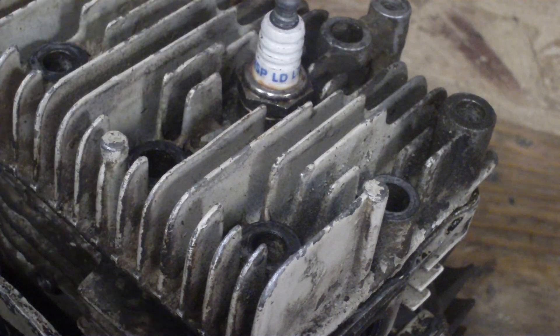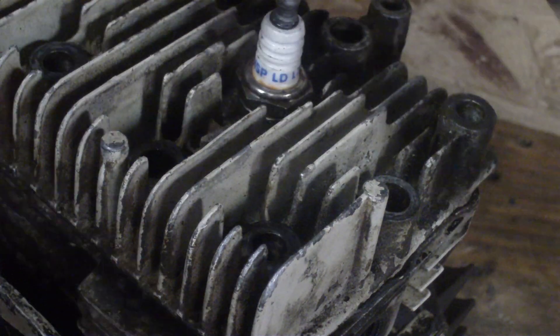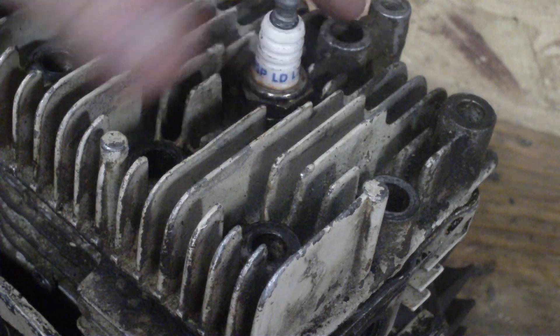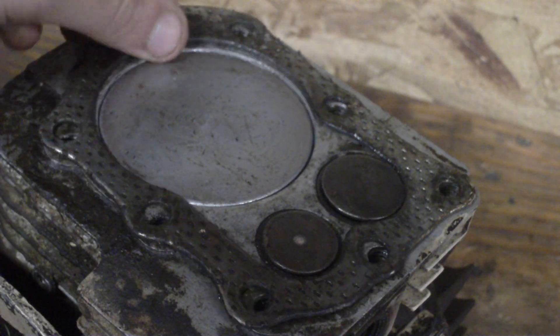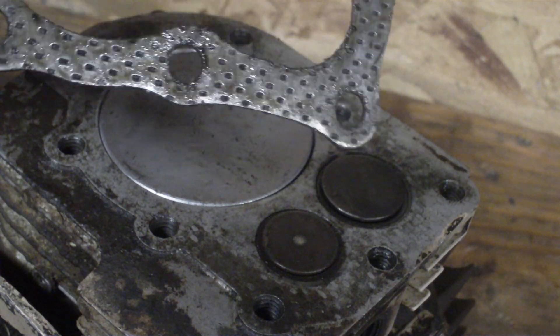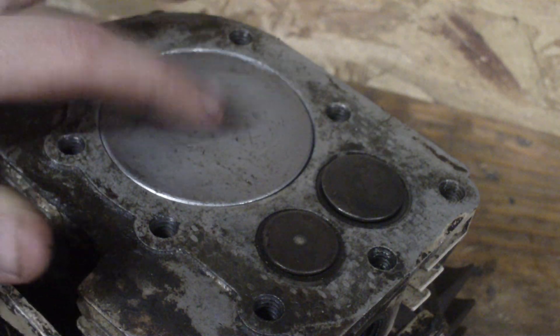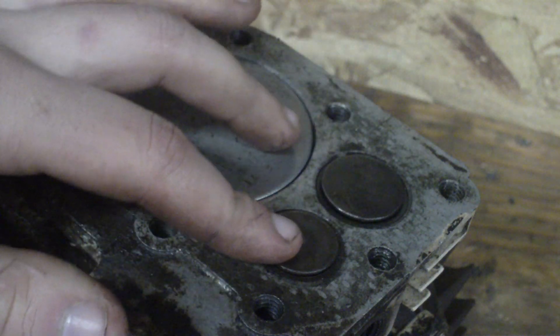I got your head bolts out. Your head is mounted on with six bolts, like that. Here's your spark plug. There's the inside of your head. It's called a flathead because it's flat. There's your spark plug on the inside. This is your head gasket — it's a piece of metal with pits in it. This is your piston. This is your intake valve. This is your exhaust valve.